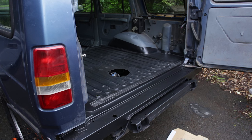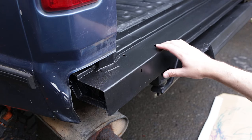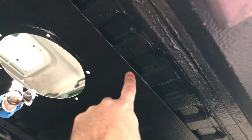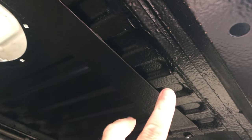I can't really remember where we're up to — it's been Christmas and stuff — but I think since you've last seen it, all I've done is painted this back piece here, made it a little tidier. The last actual job I have to do on the repair is to cavity wax all of the internal bits — areas like inside this rear cross member. But on this vehicle specifically, the other area I really want to get at is underneath, up and around these cross braces that run across the underside of the floor. Inside the corrugated shapes, obviously the under seal doesn't get inside there. So at the moment it's just weld through primer, and that will have burnt off around any welds.